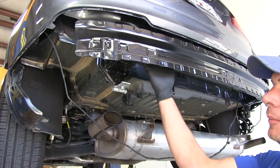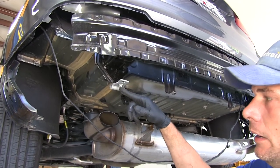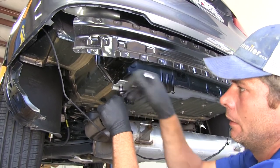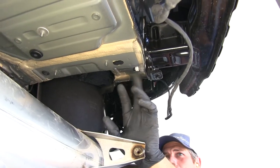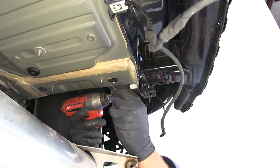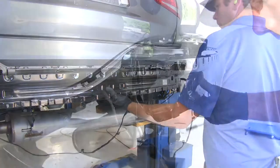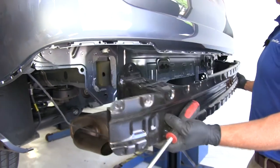In the bottom of the bumper structure, the two exhaust hangers are connected. If you have an E12 inverted Torx bit, it'll slide right on for removal. If not, you can carefully use a 10mm six-point socket — there's not much torque holding them. With those removed on both sides, take off the lock nut on the bottom side closer to the front of the vehicle on each side. We'll also have one on each side on the top part of the bumper structure — you may need an extension. Then gently pry out the double-sided tape and the bumper should come right off.